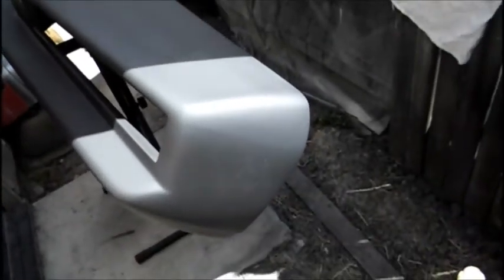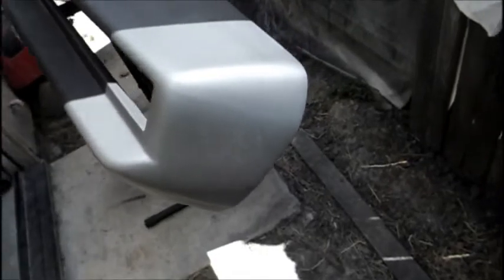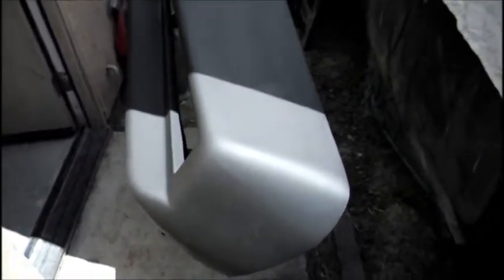This primer can be painted right over, or you can use a primer sealer. If you're doing your car at the same time, you can run the primer sealer right over the bumper as well, right before you put your base coat on. You want to make sure you sand this though, because you want a nice smooth surface. The reason why I don't sand is because I'm gonna ship it — I don't want it to get all scratched up, and that defeats the purpose of a smooth surface.